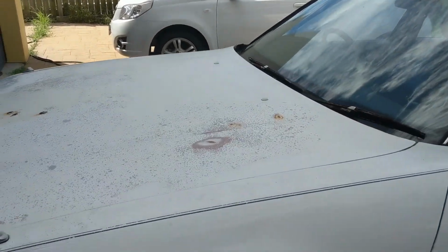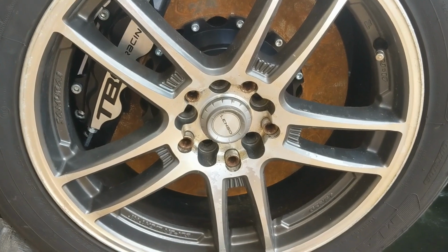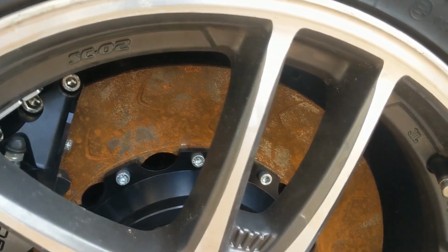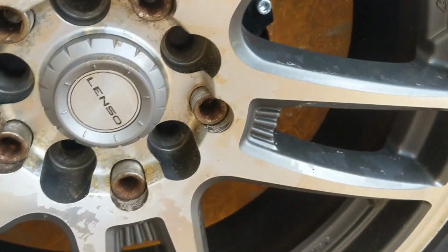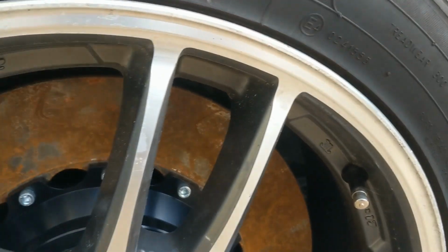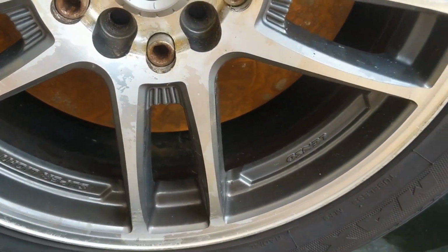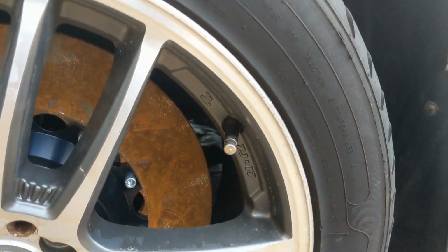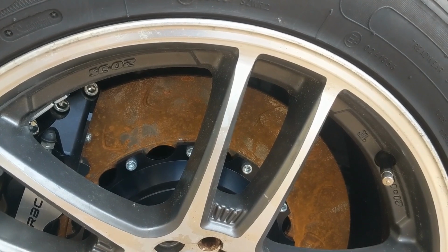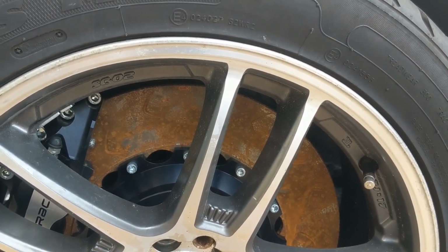But all that rain for 4 days straight, after I'd done all the cleaning and all the prepping, because I'd just put the brake cleaner on, and now I've got this nice rust surface all over my bloody brand new rotors. What a frustration. But it's okay, I can easily clean that up, just a bit of phosphoric acid and wipe down. So, no harm, no foul on that really.